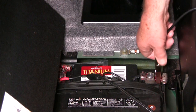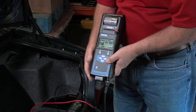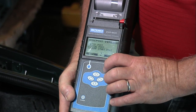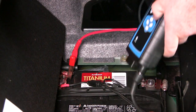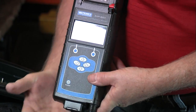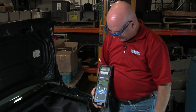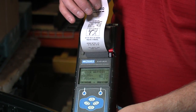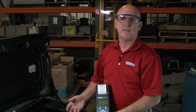Now we've come around to the back of the vehicle. Let's go ahead and make our connections on the lead terminals in the battery box. Got the negative clamp on, positive clamp on. Tester turns on and we're going to go ahead and do the battery test. Skip the warranty information, top post battery, rated in CCAs at 700. Take temperature — you may have noticed when I had my hand over it, it was about 100 degrees, so you want to make sure you're taking the battery temperature, not your hand temperature. Once it completes the test, we can validate that yes, it's still a good battery. We can share that with the customer and put it with the service records, and understand that the vehicle is safe to go back out in the street.